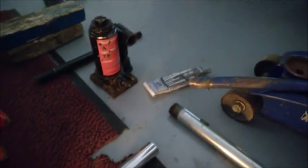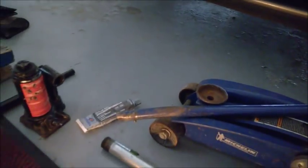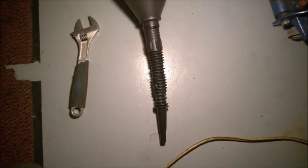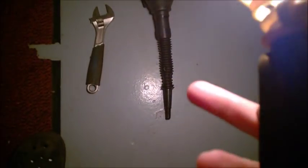Also check inside the video, because I did replace most of the bolts with another bolt, which actually is the same as for the skid plate, the large plastic plate. It has small bolts with a hex head this time. You can replace all 9 with those hex head bolts. Volvo sells them from $1 or something like this, and they are the best option. That's the bad guy, that's the Torx one. You are going to remove it with a 40 Torx. Do not use a lower Torx. So again, this is your fighting guy, and this is what I used to replace all 9 of them. We will also need this kind of long funnel with a small tip at the end, because we are going to refill the transmission through the dipstick, and the dipstick is rather a thin tube.